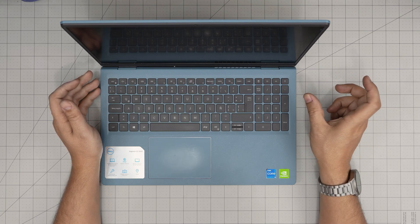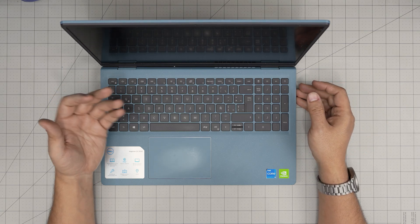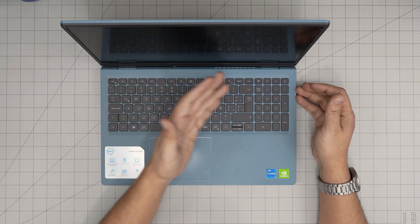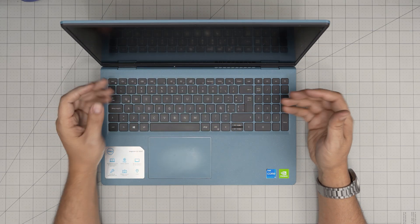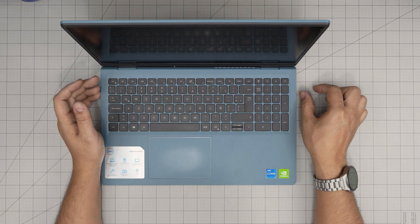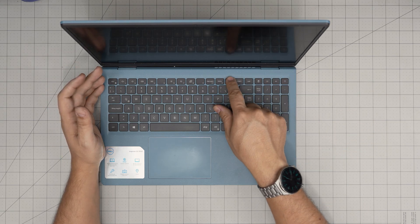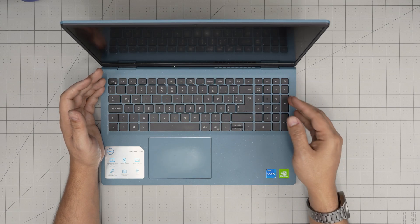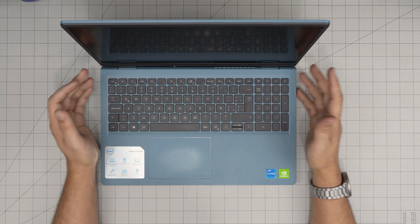Once you create the Windows USB boot drive, plug it in. After replacing the main storage, power on the laptop and it will boot through the USB and take you through the installation steps. If it doesn't boot automatically, plug in the USB, power on, and start tapping F12 — that will let you choose where to boot from, then select your USB.